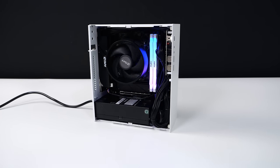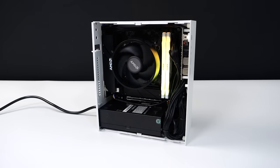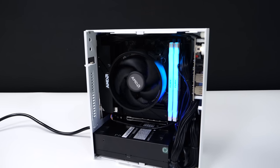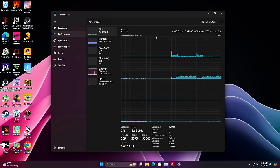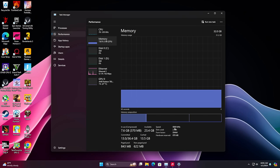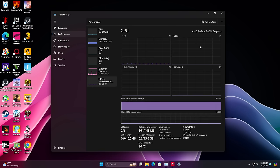Faster RAM is going to help out with this iGPU. I've got Windows 11 Pro installed and everything up to date. We've got the Ryzen 7 8700G with the 780M graphics, running at 8000 megatransfers per second. I've run some benchmarks already and it's looking really great for an iGPU. I did go into the BIOS to dedicate 8 gigs of RAM to the iGPU, but it looks like it didn't take — either way, it will still allocate up to 16 gigs as you can see in Task Manager. Some games may detect less RAM and we'll have to skip one prompt, but not bad at all.